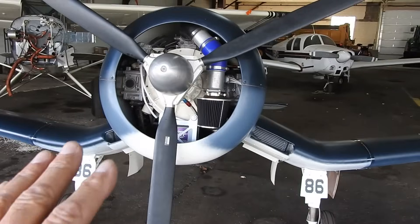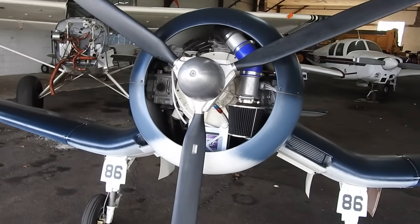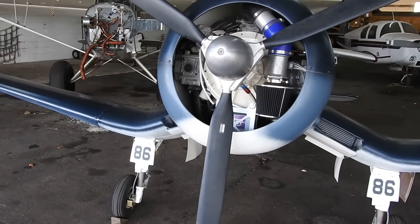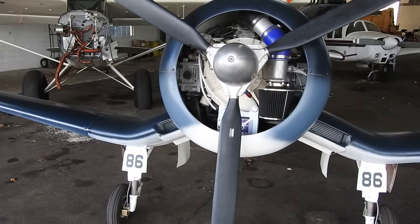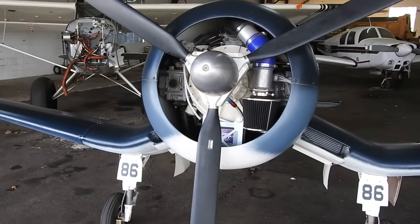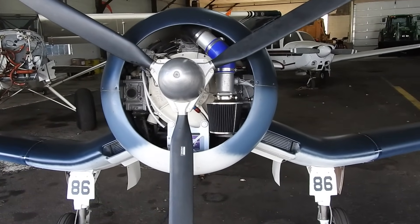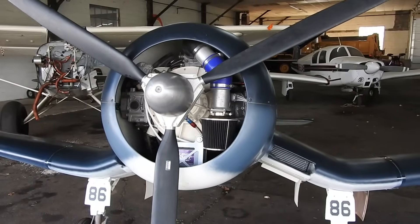If you're a pilot or know anything about piloting an airplane, whenever you take an airplane up before takeoff you always do a mag check. You gotta run the engine up to RPM and turn a mag off, turn a mag on — you got two mags, left and right. You check for an RPM drop, and if you get more than about 50 RPM drop then you got a problem. Or if the airplane runs rough or something like that — you don't fly it. So when you have a problem, you pull it back into the hangar and you get someone to check it out.